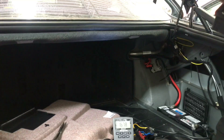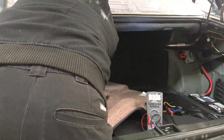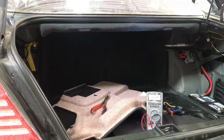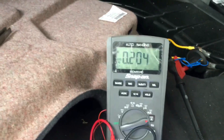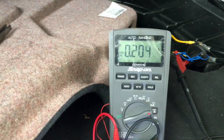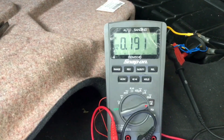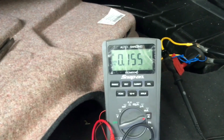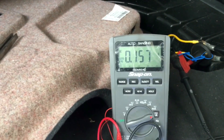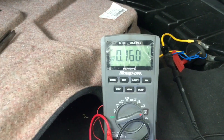When I unplug the pump, the amperage goes down — watch this. I just unplugged it; both cables are out. It's actually going down. I'll be happy at 0.05 amps, but anything with 0.0 I'm okay with. Sometimes it does take a while to settle.